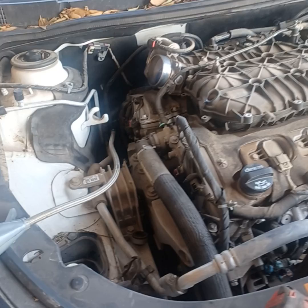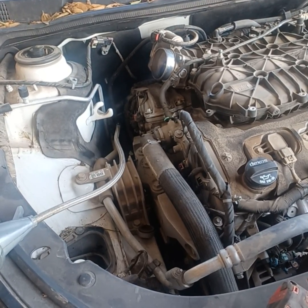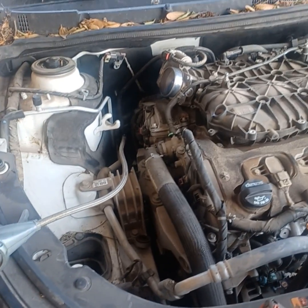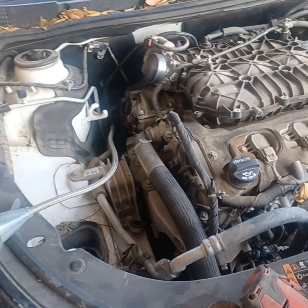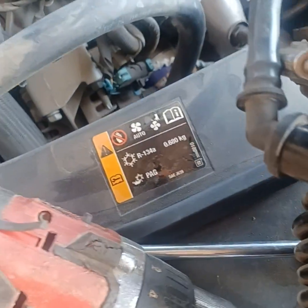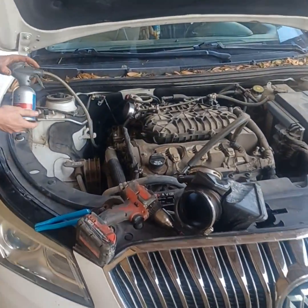You've got to be careful what refrigerant you put in here. Google it if you need to, because most vehicles up to 2019 or 2022 have R134a, but they're changing it. There's also a tag on the vehicle — you want to find that and use the right freon. You don't want to just start pumping anything in there.